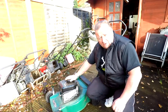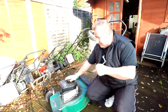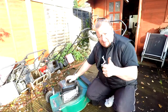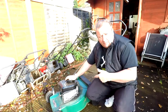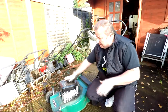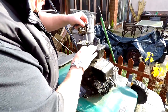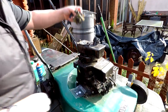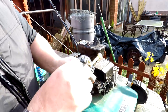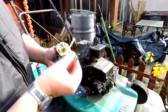It just needs a new diaphragm and gasket, which was one of the things I did replace two years ago. Over two years — don't forget, these were pattern parts I put in. The two pattern parts I fitted to the carburetor were the diaphragm and gasket, and the primer bulb. I'm sure if I change the gasket and diaphragm and put a brand new one in, this will be running perfectly again. Let's take this off again. You can see it now — the wrinkled up diaphragm. It's probably because it's old and it's knackered. Two years old — patterned diaphragms don't do the job.